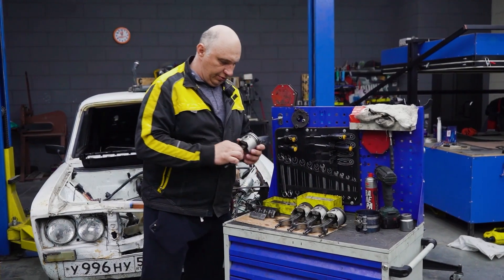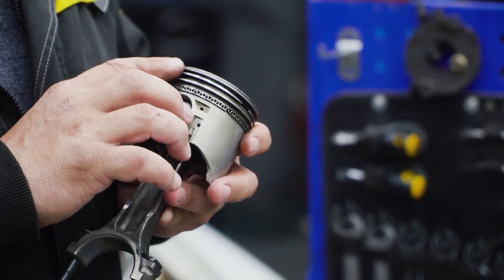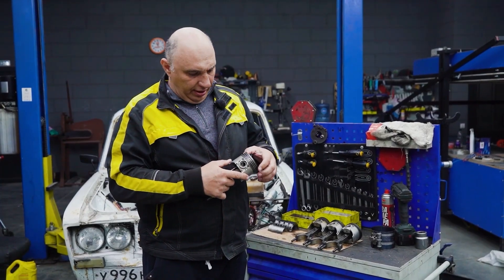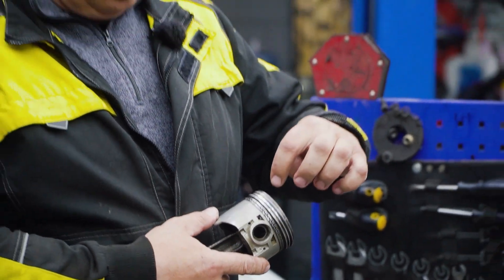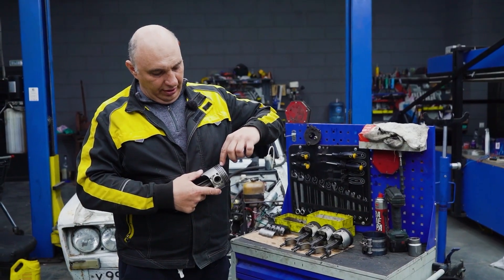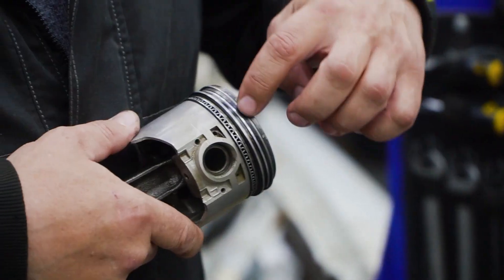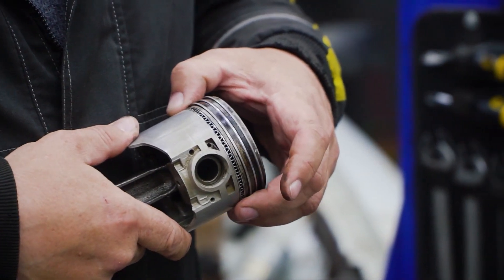Check out what we got here. The upper two slender compression rings — I guess we could have placed them together into one groove, but we decided not to go that route. Instead, we thought we'd go hardcore and modify the crown area of the piston, where we had a bit of space to accommodate another piston ring groove. That does leave only a thin ring land, which isn't ideal. Anyway, we cut the groove and the ring moves around nicely in it — all of them do, as a matter of fact.